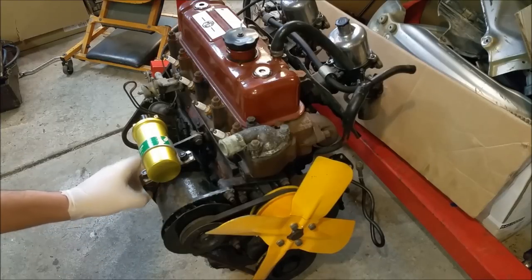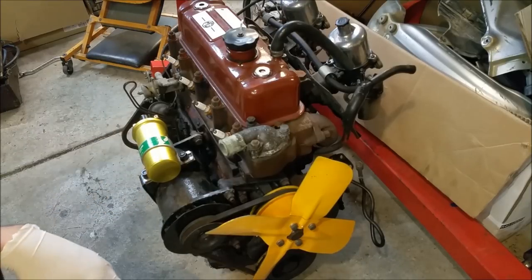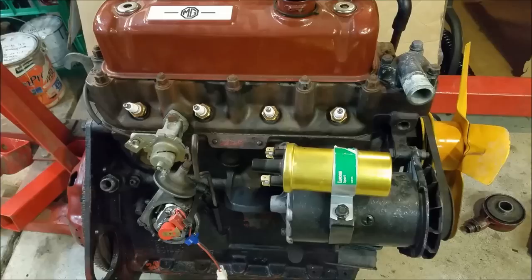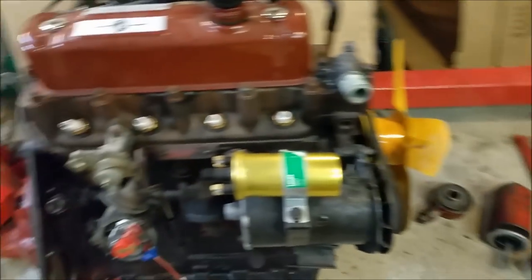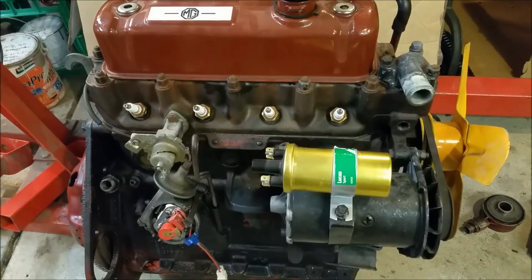Wolseley 1560 bracket for the coil. The coil was initially mounted down on the block, but I didn't want to use it like that - I prefer it up here. Moving to the side, this uses a cartridge type oil filter. There's an adapter there for the oil cooler. A lot of people like to put the spin-on type filters and you can get an adapter for them. The 2480 Wolseley uses a vertical type oil filter, but the issue is you need an oil filter with a stand tube in it because they do drain down. I'm staying with the cartridge type.